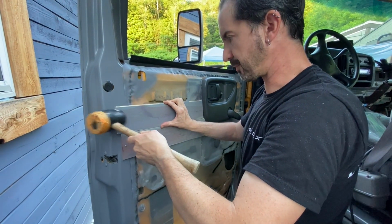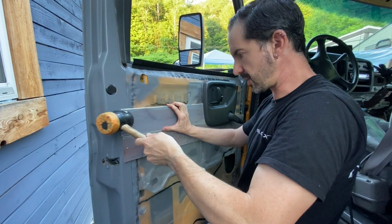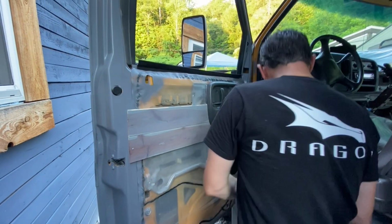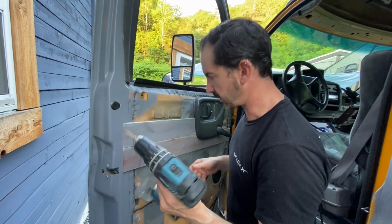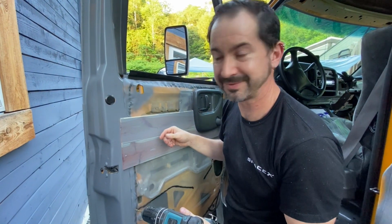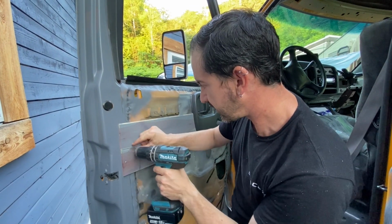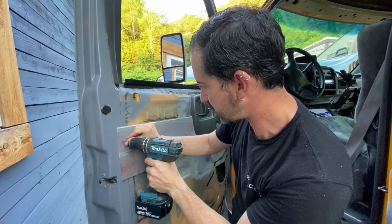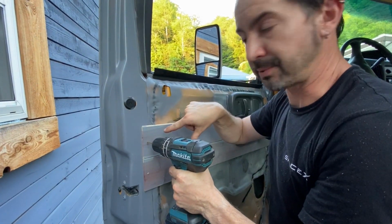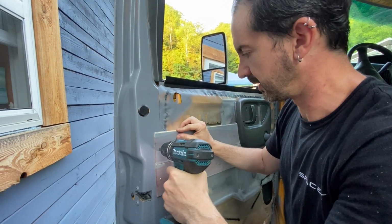And this is sort of a multi-step process. First, we had to put a full-length piece in here to figure out where it needed to cut. Now that we're in, we need to drill our spot for the rivet. Pilot hole. Rivet. And I'm just eyeballing it roughly in the middle, above the knot. Yeah, roughly a half inch in. I'm going to call it right about there. I'm going to drill through the wood and then stop just as I make a dimple in the metal, and then come back out and cut the metal hole properly with my cutting oil and all that other good stuff.